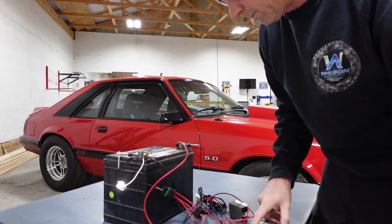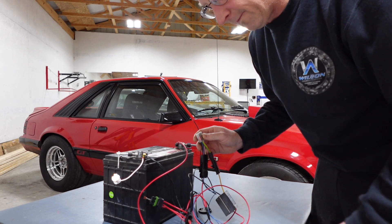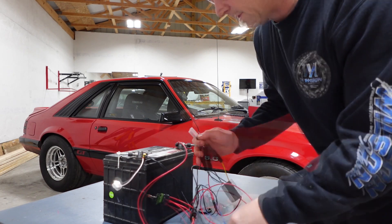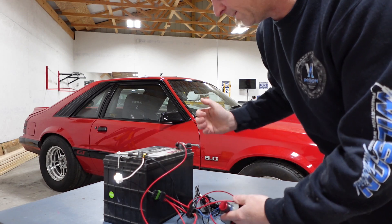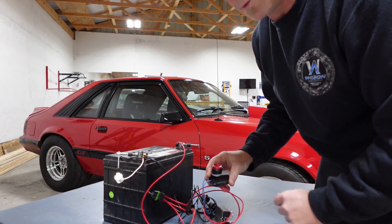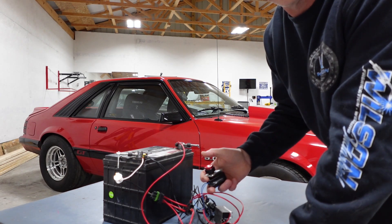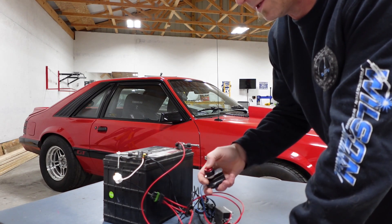First setup — it's probably the simplest and will work for anybody. It uses this little timer from the Timer Shop (link in the description), a solid state relay (also in the description), and some kind of momentary switch. I've got this wired up to make sure the timer is configured right. I'm going to make a short separate video on how to configure the timer. Right now you can see the light is on — that's assuming you're in the car with the trans brake button pushed. This little momentary switch is representing the bump box. I've got it set for a tenth-of-a-second interrupt, so it should go out for a tenth of a second when I hit this button.